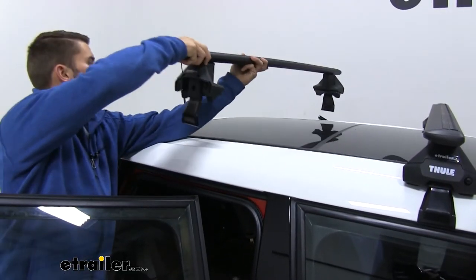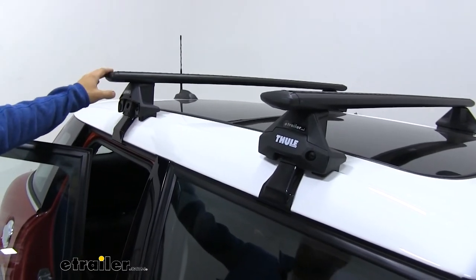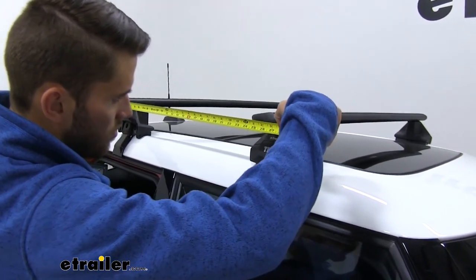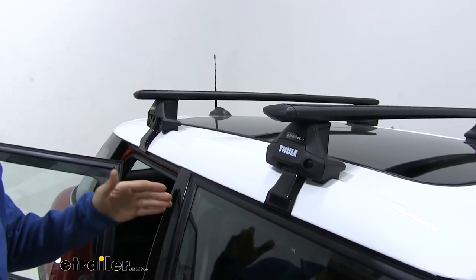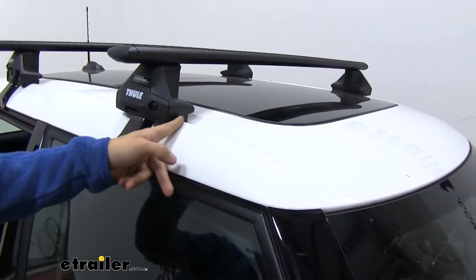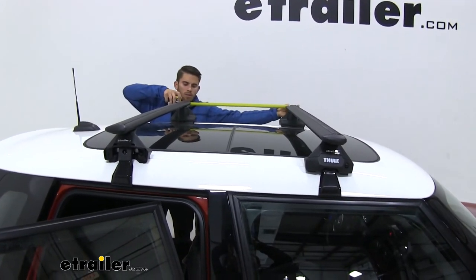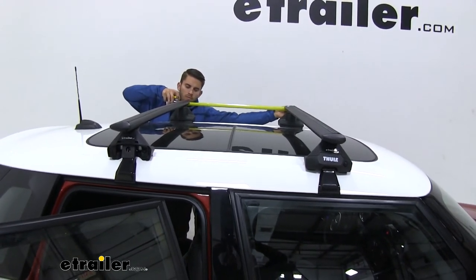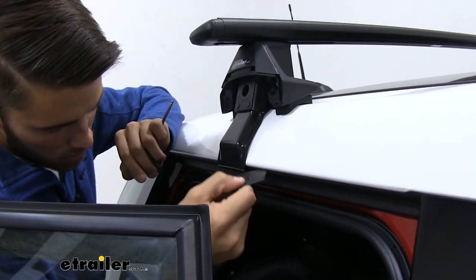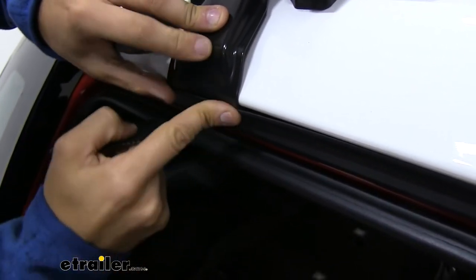With both rear doors open, we'll stretch our roof rack across to get it set into place. Per our instructions, our crossbar spread needs to be 27 and a half inches. We'll measure from the front of our back wing bar to the front of our front wing bar — 27 and a half inches — making sure to get that even on both sides. For the front bar, we measured from the top corner of our windshield to the edge of our Evo clamp foot, about 12 and 3/8 inches on both sides. Now our rubber-coated hooks have to go under the weather stripping — the kit includes a small tool to wedge it in, pull down the weather stripping, and get the hook seated. We'll do that for both sides.